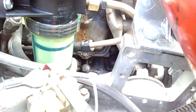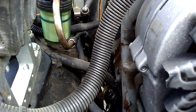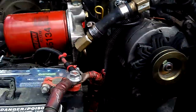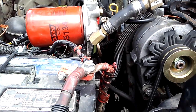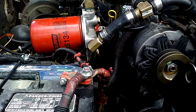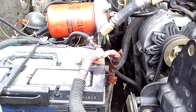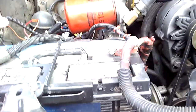I kind of over-killed it. You can see the nylon line there — I ran that nylon line back, and because the line wasn't long enough I think there's one more section where we flared another piece of metal tube with a quick connector going directly to the tank. I also deleted the fuel selector valve — another area prone to leakage. I'm just running one tank at the moment; if I want to run two tanks down the road I can always put it back in and plumb it back in.